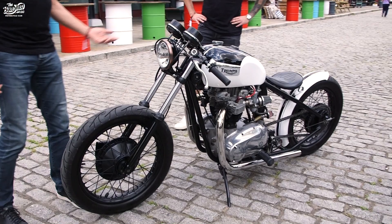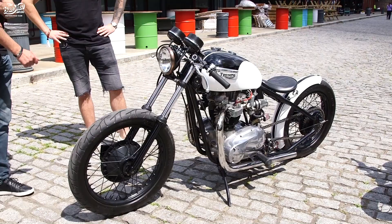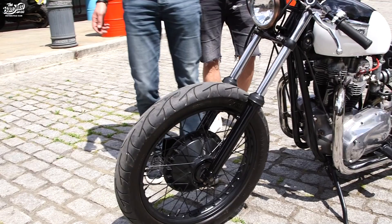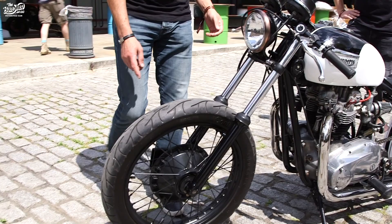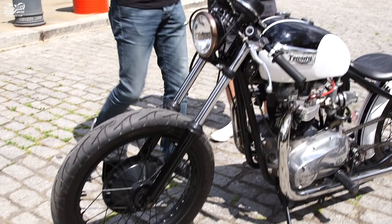Just starting around at some of the details of the bike. A lot of it is very standard, but they look far from standard — and a lot of that's to do with the frame modifications. The front end of this particular T120, which is an original Bonneville, is really a standard front end: standard height, standard conical hub, twin leading shoe front brake, 19-inch front wheel. Obviously they're chromed wheels at the start, but this has been stripped off and two-part acrylic painted.